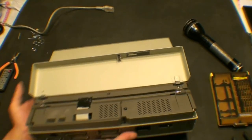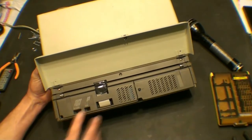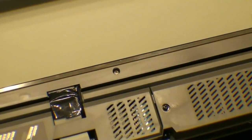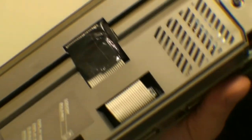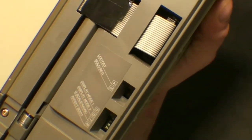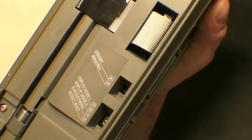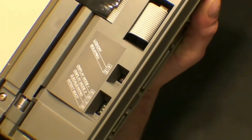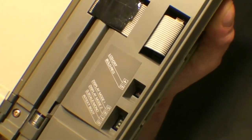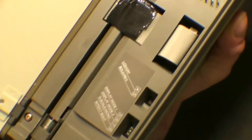It's tagged Sony SMI-2100 LCD unit. And that covers up some DIP switches for LCD and CRT selection, bold and regular type for the display, display mode 1, display mode 2 — which I'm not sure what they do — grayscale and mono selection, and internal and external booting.